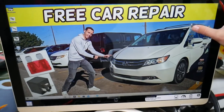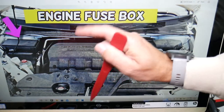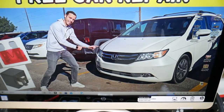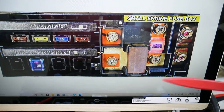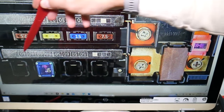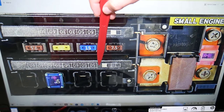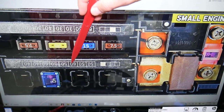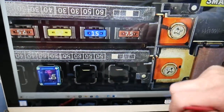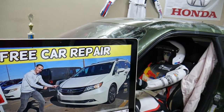We have one more fuse box located under the hood. We're talking about a secondary fuse box — not the big one, that little fuse box right here. Open the cover and you'll see a layout that looks just like this one. We need to find a multi-block fuse — a special fuse. If you want to see where to buy them, the link is in the description. Come to that side and count one, two, three — that third fuse is a 60-amp fuse. That's the one responsible for powering the rear junction box on your Honda Odyssey.